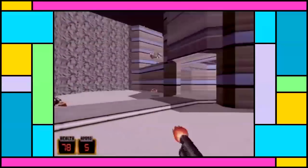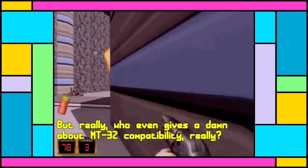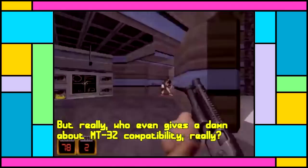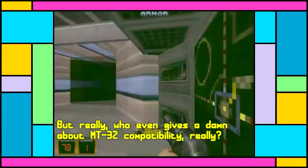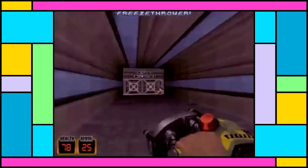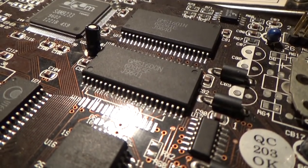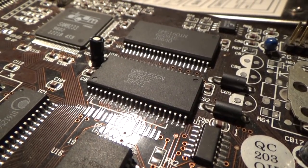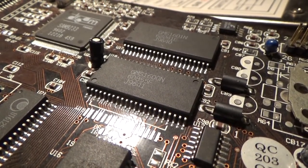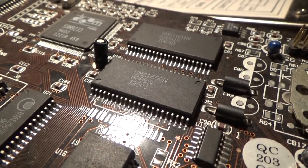Anyway, this wavetable hooks into the Crystal's auxiliary input directly. It appears to be mostly GS and GM compatible, and at least everything I've done with it up to now has worked just fine. It also claims to have an MT-32 mode, but I've never used that. There are apparently two sound sets on this board at 2 megs each for a total of 4 megabytes of ROM, which is actually quite impressive. I believe that's at least double the Sound Canvas.